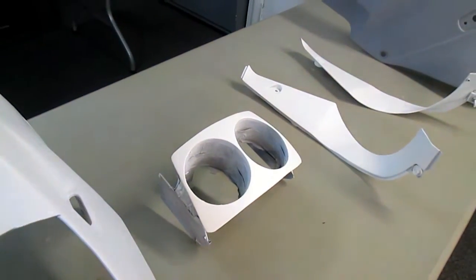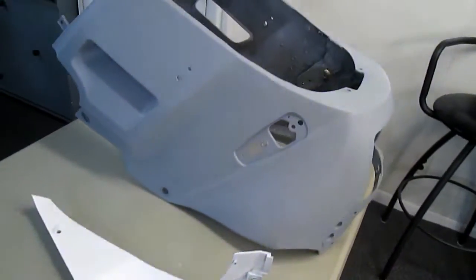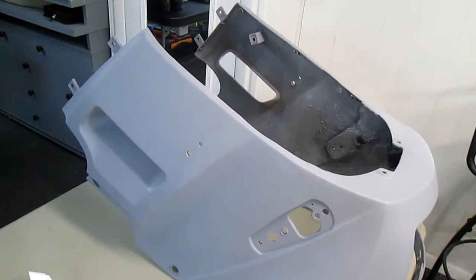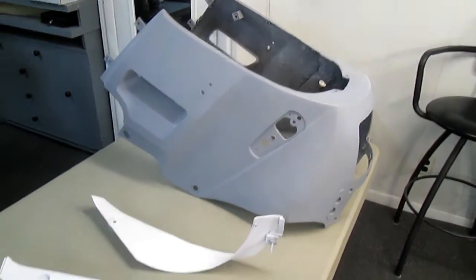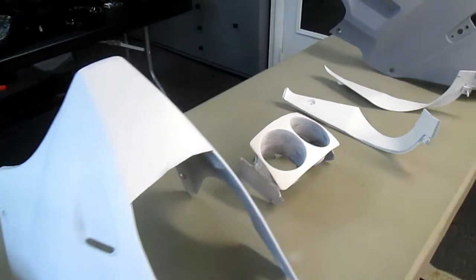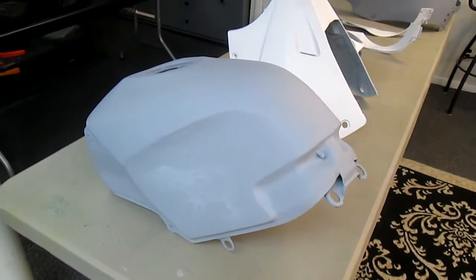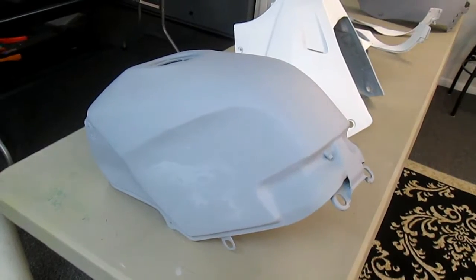These guys that we had tremendous fisheye problems on, they're in the bank. And then there'll be a separate day I want to really allocate to this. It's got a lot of repairs and a lot more bodywork on that. So we have our work cut out for us, and the idea now, and I try to always explain this to people, is I try to pick a job that's appropriate for the day. So the first thing that's appropriate today, of course, is indoors. I'll spend an hour or so with some 600 paper and get this detail sanded.